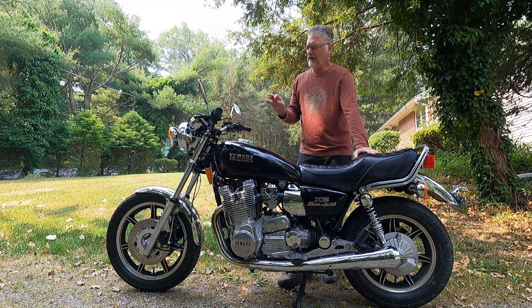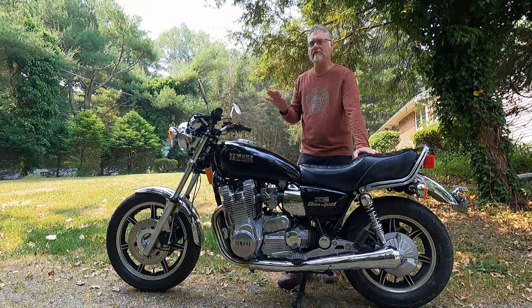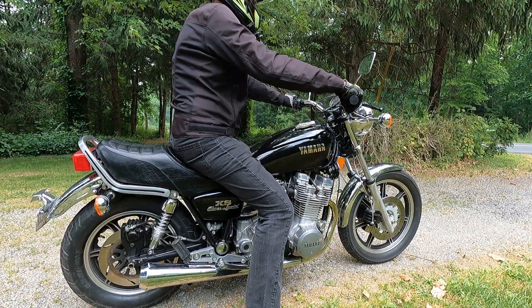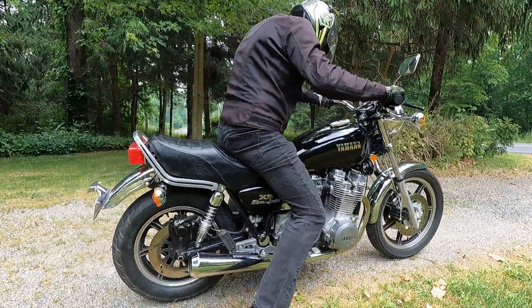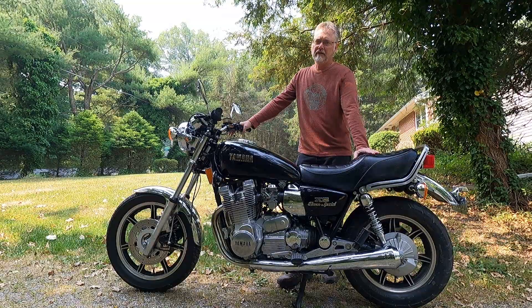What I did was install an inline baffle where I necked down the inner diameter to a smaller diameter. Other than just a little bit of tapping right on startup, I get no noise whatsoever. The bike runs really, really well — after driving it for over 100 miles I did not have a single hiccup and I did not have any cylinders cut out. The new vacuum advancer and the inline baffle have solved that problem and it really runs nice.